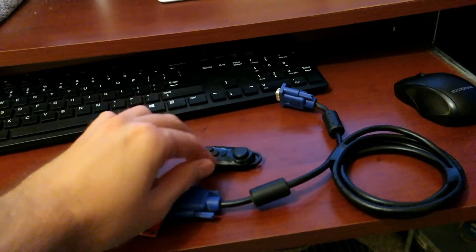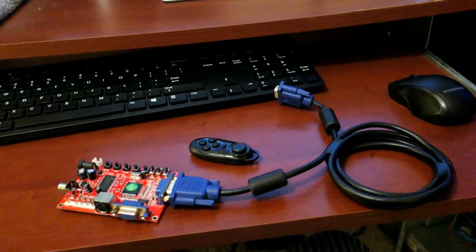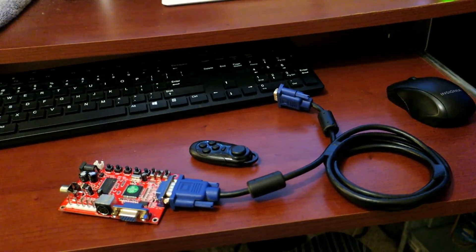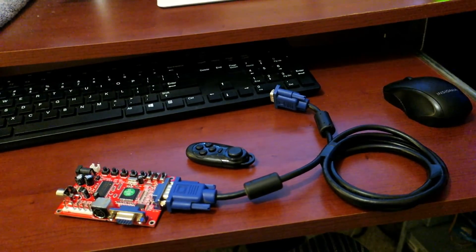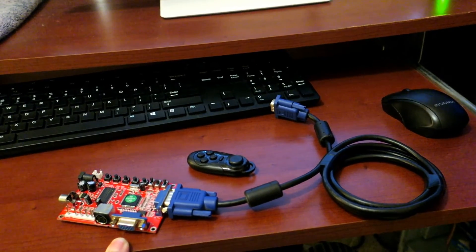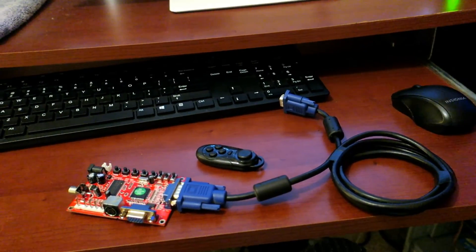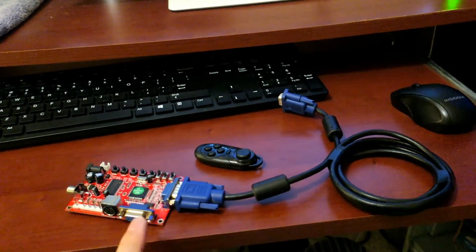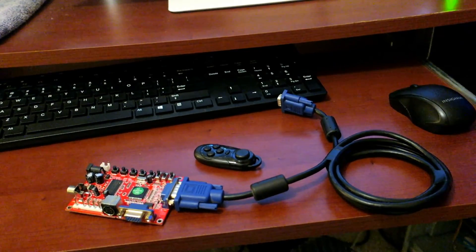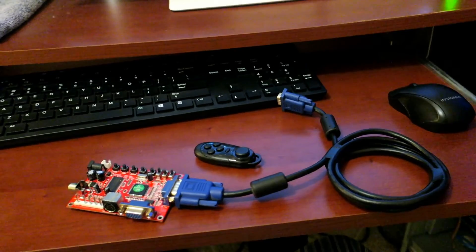I'm also going to show in the next video how I use this wireless Bluetooth joystick to control the phone — I can maybe mount it on my steering wheel, or just keep it off to the side to interact with the screen without touching my phone. In terms of audio output, I have an app called Soundabout. It allows me to, even while I'm casting my screen, force Bluetooth streaming to that Bluetooth audio adapter I have connected to my auxiliary port. The benefit of that is it's an easy way to not run wires, and the main thing is steering wheel controls work. So if I want to change tracks while listening to Spotify, it will work.